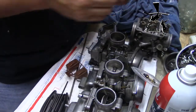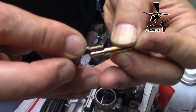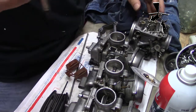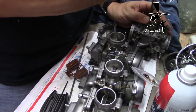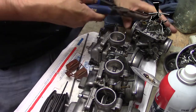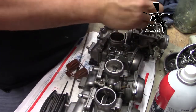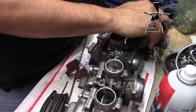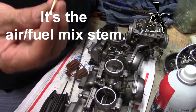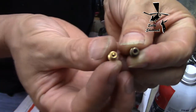Let me make sure the stems are the same length - yeah, it does look like the stems are the same length. There are probably some pros out there yelling at their screen, but whatever - I am not a professional, I'm just trying to get this thing running. I'll just use a pair of pliers. Huh, that's weird - it didn't come with this piece. I guess you don't need this, so I'll put this back in. This jet here - I'm not sure what this jet is for, but it looks a little worn out, so I'm gonna go with the new one.